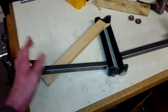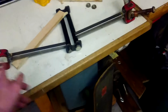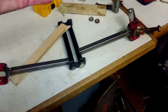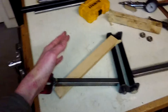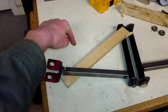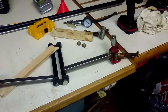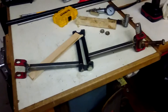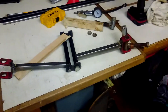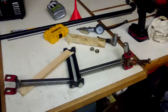Also, if you can get your inside tire to crank more than your outside tire, you won't need to slip. There's math involved, and it depends on how long your body is. The simple way is to just draw a line to the center of your rear axle and then put your steering point there while your wheels are straight — that pretty much lines up the way you need to be. But it also depends on how wide the front end is and how wide the rear end is.